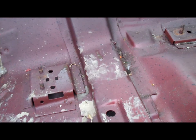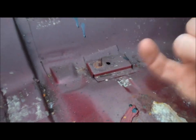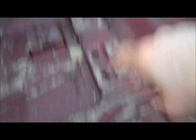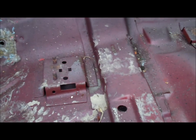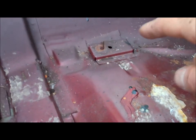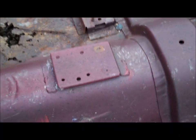All you really have to do is bolt those inner brackets to the bucket seat frame itself, set the bucket seat in the car, bolt the seat down on this side, and those brackets will line up exactly where they need to go. Mark the spots in the floor and tack weld them in — it's very easy to do as far as the bucket seat installation goes.